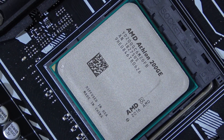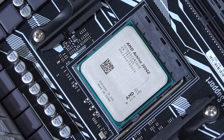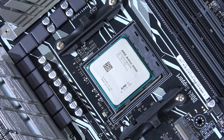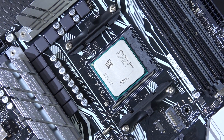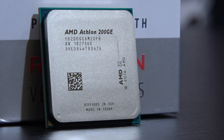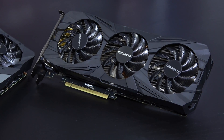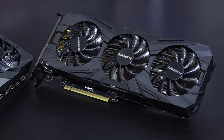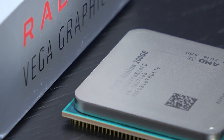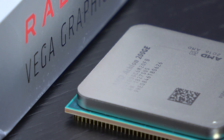What's there to say about the results? I will admit I have some mixed feelings — I just can't quite fancy this Athlon 200GE. But it's definitely not bad, especially when considering its low price. It makes sense that this dual core is some sort of a snail, which is proven by most of the tests that were run. It is also clearly visible how pointless it is pairing such a low-performance CPU with a beefy graphics card like a 1080 Ti. If you're in a situation like this, you will experience some heavy bottlenecking.